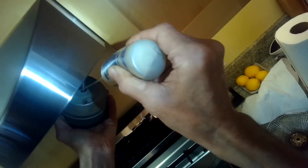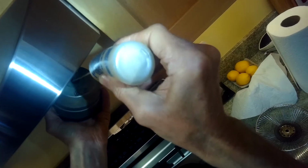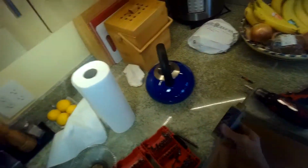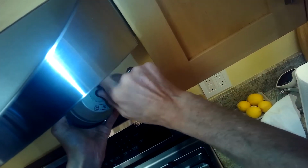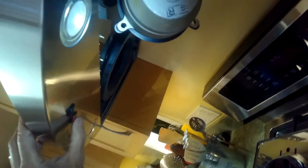I'm also going to try just lubricating this affected bearing by turning the motor upside down and letting gravity feed the oil in there without removing the case to see if that may help. So once I put it in there, I'll spin it to help distribute the oil. I just got a feeling that the bearing sat in that rainwater too long and may have rusted. When I turn on the power, it spins fine, but it's just still noisy. One on the left sounds really good.